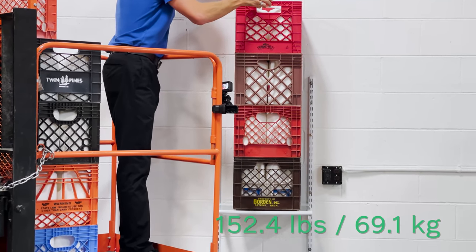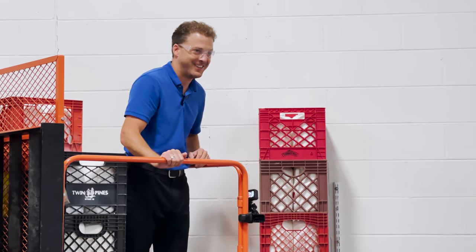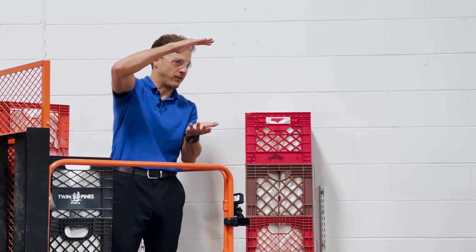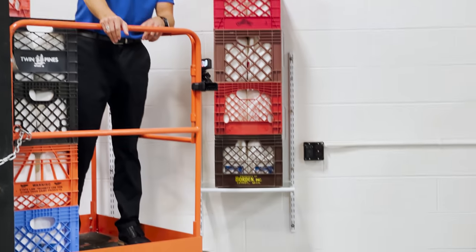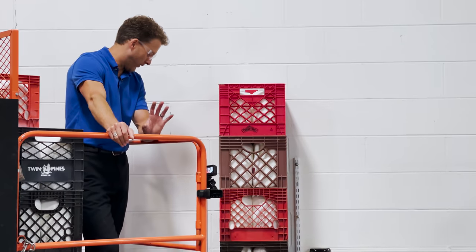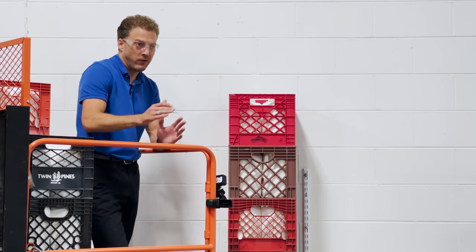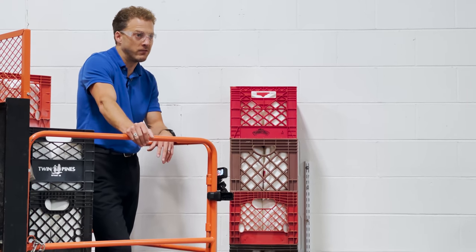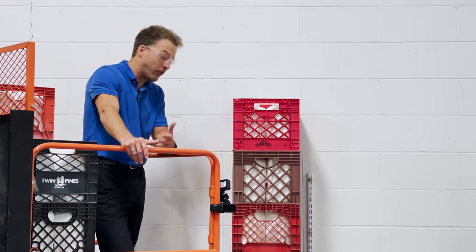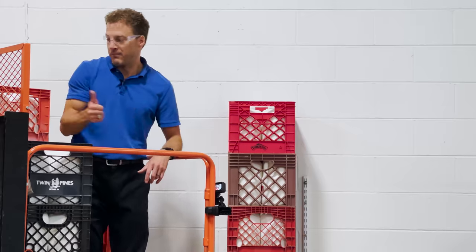What do you have to say, Adam? I'm impressed. So what do you think is making it hold up? Is it the depth of the arm? Yeah. You think so? I think it's the depth of the arm. And here we were, I was focused on the gussets and the cross section of the arm when we should have been worried about the thin points near the attachment to the wall. All right. That's interesting. Well, that makes sense if you were to do a stress analysis of that part. Most of the stress is going to be back at where it cantilevers off the wall. All right. Keep going. I want to see. Alrighty.